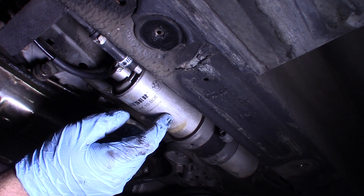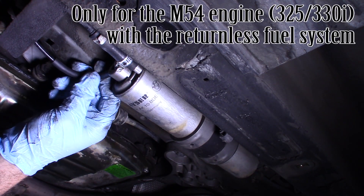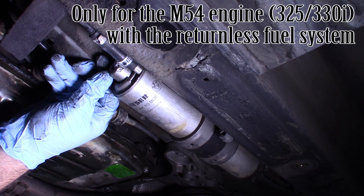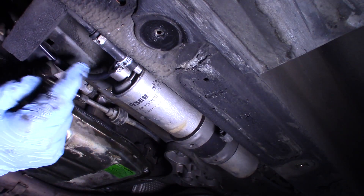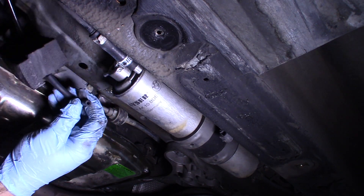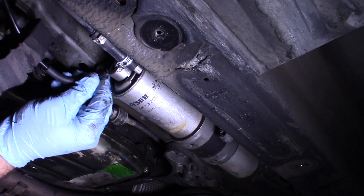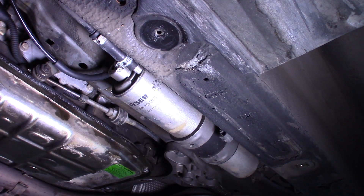This is the combination fuel filter and the fuel pressure regulator on the front of it. This is the vacuum line that comes from that little F connector on the upper intake. You should replace this vacuum line, by the way, if you have not done so already. I've replaced it, but it was pretty dry, crumbling, and cracking, just like all the vacuum lines on my vehicle when I first got it.